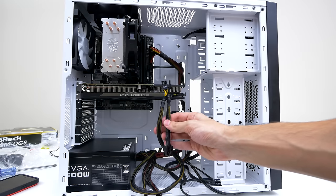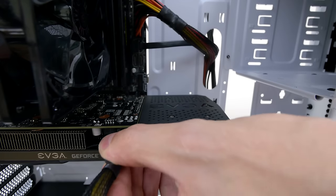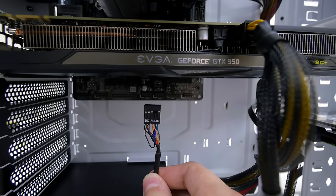Now we are ready to hook up the PCIe cable to power the graphics card, so grab the cable that has the words PCIe printed on it and insert it to the side of the GPU with the letters facing upwards. These next set of cables are connected to the case, so grab the cable that has the words HD audio on it